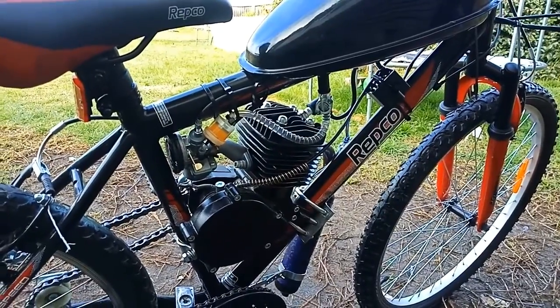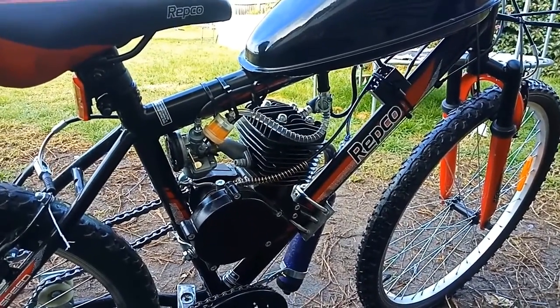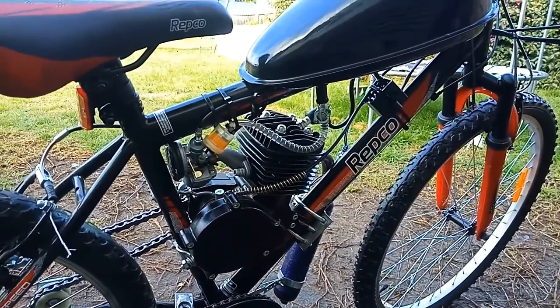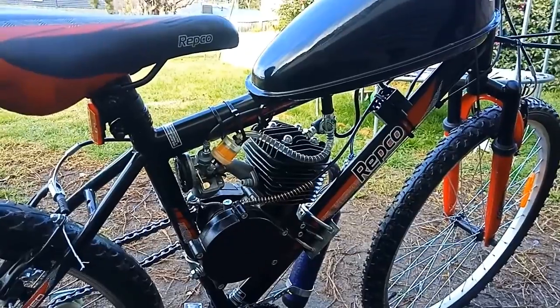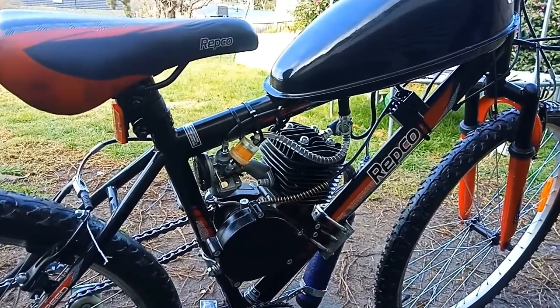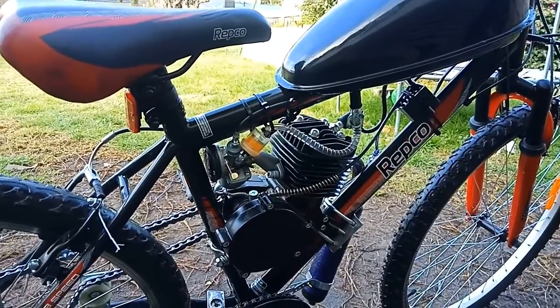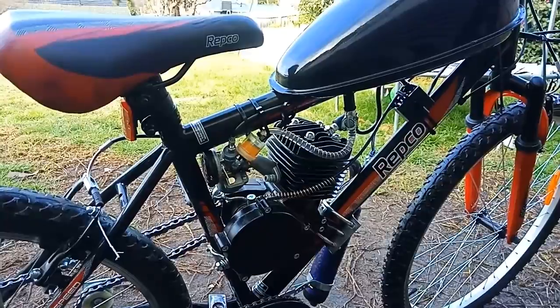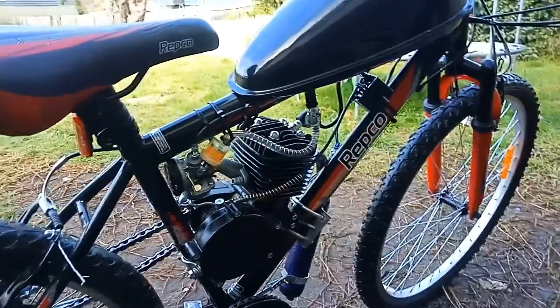So we're having some new engine dramas. What appears to be happening is that CDI boot is slipping off that spark plug. Now that's just the cheap plug that came with the kit. So I'm going to throw in one of my spare NGKs and we'll go out again. I'm thinking maybe weak spark might have something to do with torque delivery.